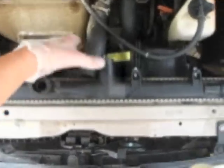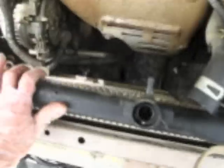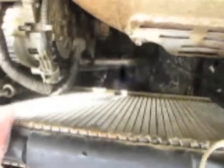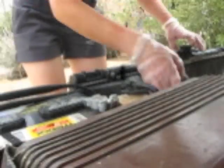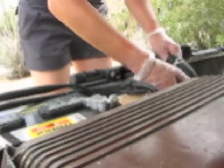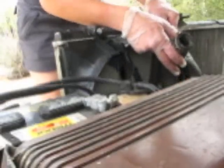Pull it out — it'll probably leak some more on the side, so be aware of not getting it on yourself or on something that animals will lick up, because this stuff is pretty nasty. Now you just got to lift the radiator out and make sure the hoses stay out of the way. One hose is coming with you.